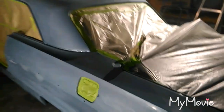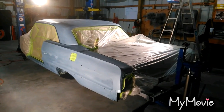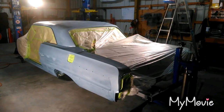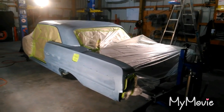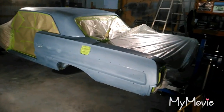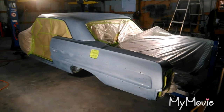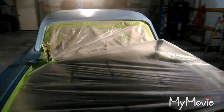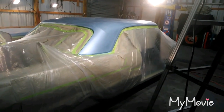We're just going to focus on the hood, trunk, and quarter — maybe paint them separately. That way I can focus more attention on the issues versus trying to spray the whole car in one day. I'm feeling pretty good about it. The main thing I have to remember is: I can slam the clear on flat panels, but I can't slam it on the quarter because I don't want any runs. If I can pull this off without any runs, there are no runs to sand period on the entire car, and the cut-and-buff process should go very nicely.